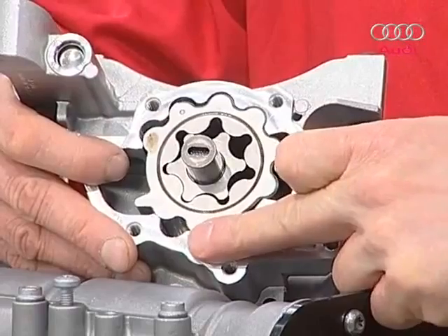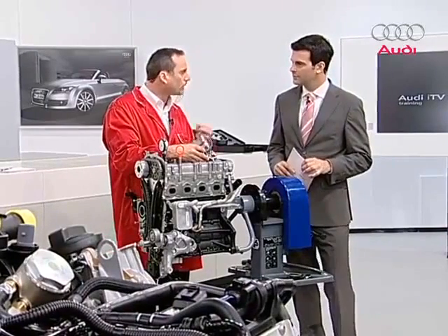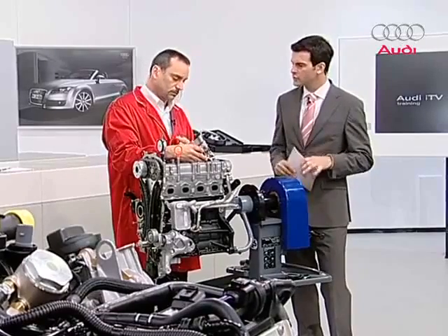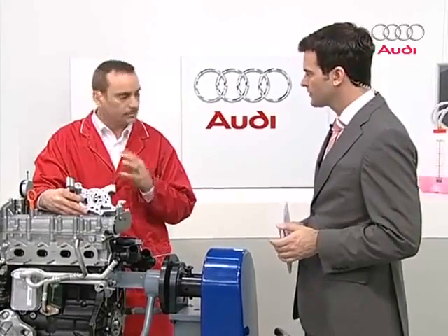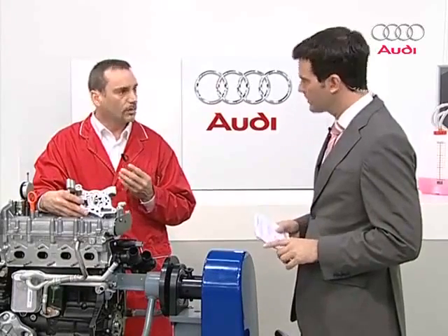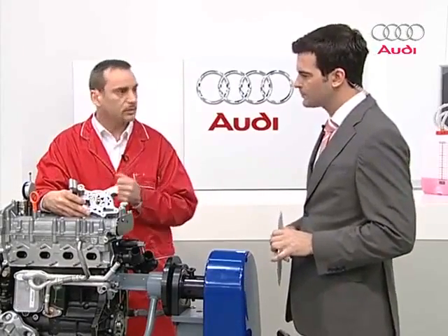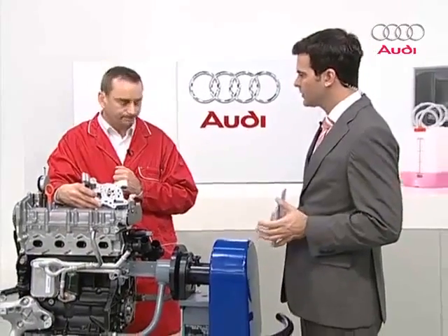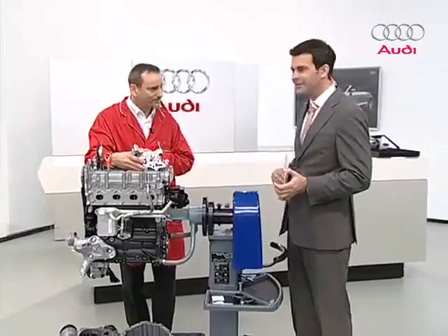We continually keep the oil pressure at 3.5 bar plus or minus one tenth of a bar, regulating the oil volume to attain the thrust the engine requires. It's quite impressive in such a small area — a simple, electronics-free system. Something similar was installed in the V6 engine with AVS, but that system is electronically regulated by the control unit using electric switch-over valves. It's more complicated and regulates oil pressure rather than oil volume, with varying pressure levels. This new system keeps pressure consistently at 3.5 bar.